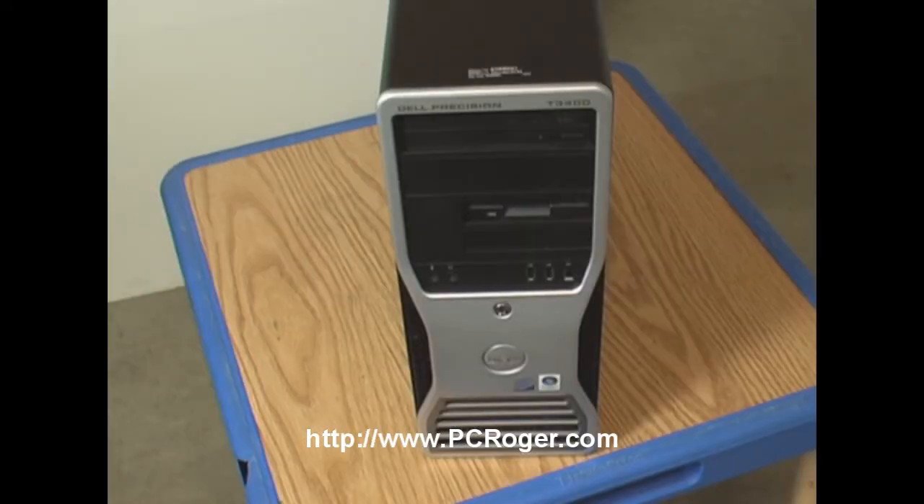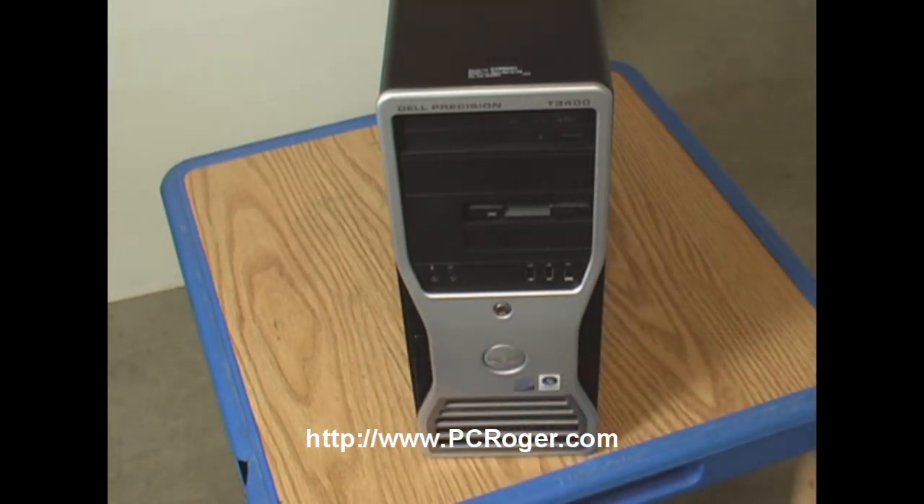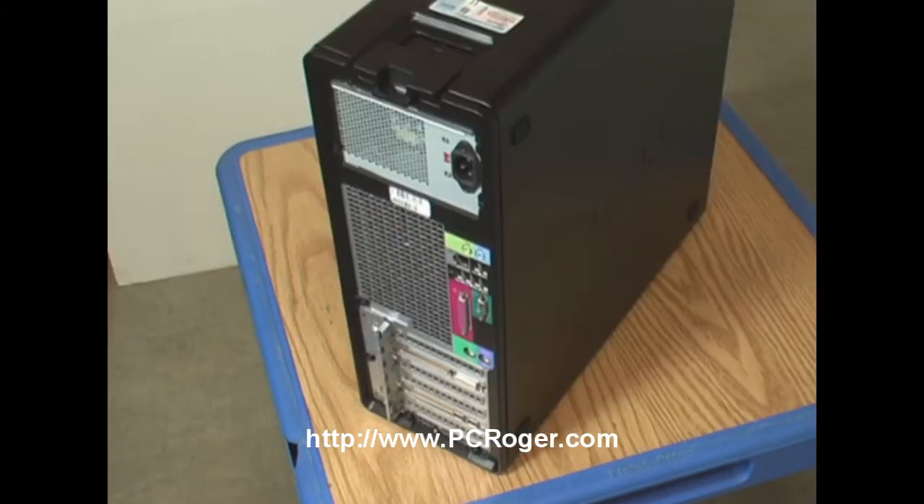Here's a newer Dell Precision workstation T-3400, and you can see on the front of the box and down below just a lot of vented areas that are hopefully going to draw air through. Those will need to be cleaned out, and it's pretty easy to do. Again, that kind of compressed air will do a nice job. Here you can see the back of that same machine — all those vented screen areas are going to need to be cleaned out. There are potential areas for dust, dirt, and lint to get in there and block the airflow.